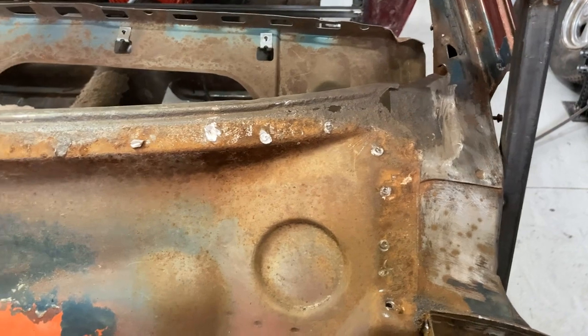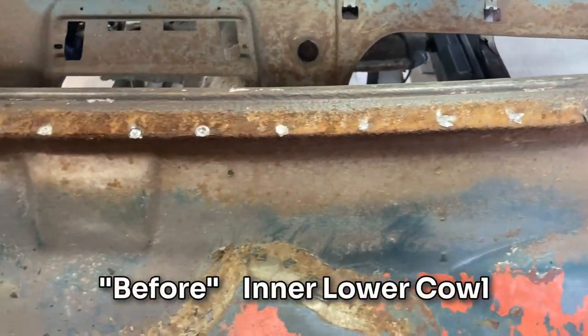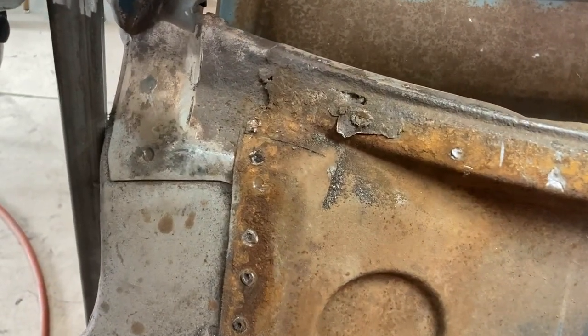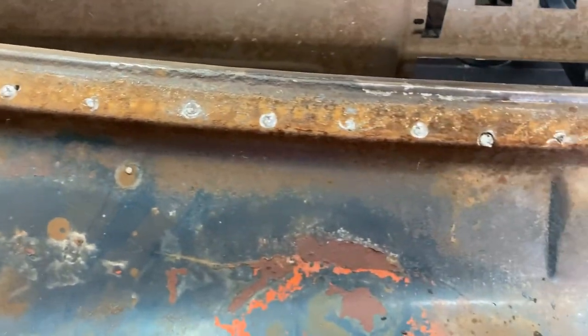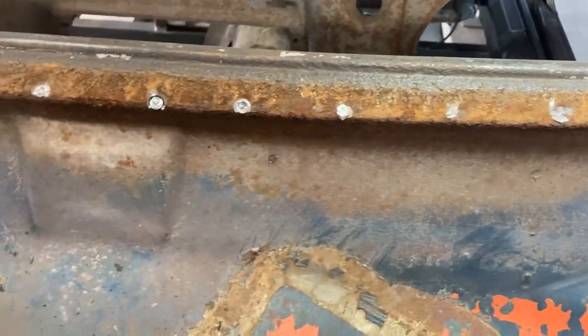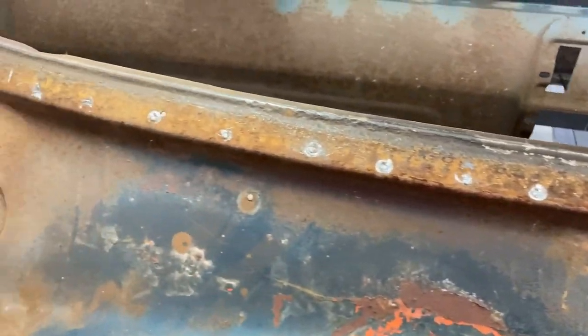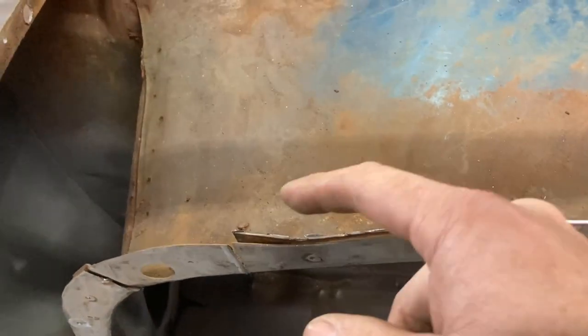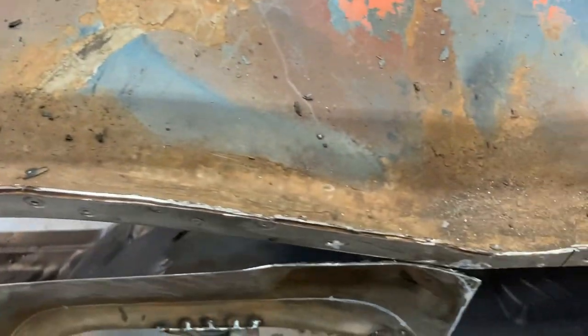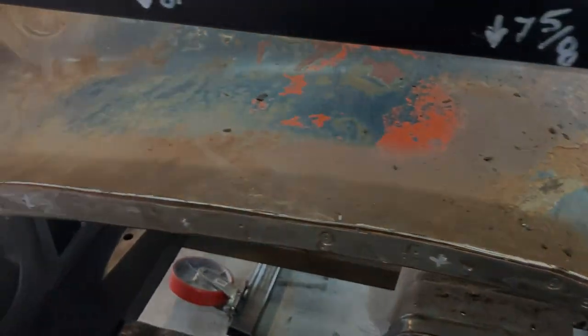Here's the underside of the dash — the infamous before picture. I haven't cleaned off any of the rust. I'll have to rebuild that corner a bit once this is all cleaned up. That corner will need to be rebuilt; other than that, I think it's pretty good. There's still one layer of metal from that upper air box I want to get off — no point in leaving it sandwiched there. So I peeled that off, dressed it, cleaned it, and I'm good to weld to it.